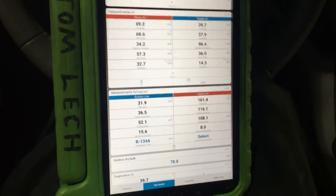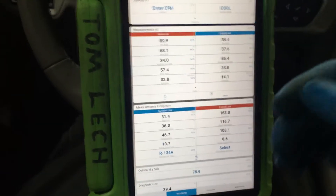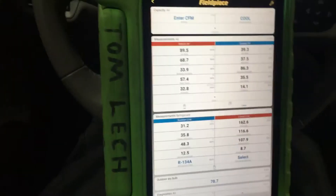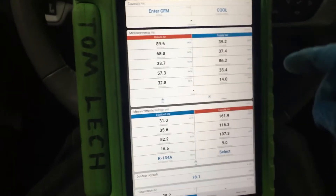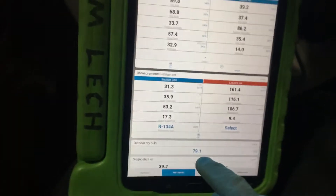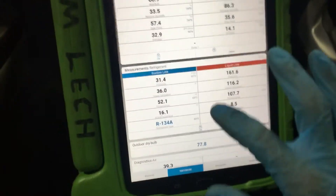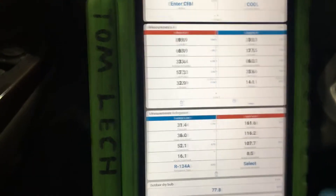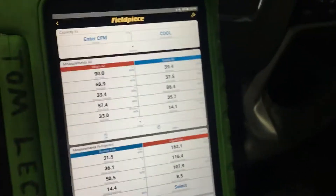Here's a dual AC system. I'm not going to hook up gauges on the rear — I don't have time — but I'd like to take at least one shot today. It's 84 degrees outside right now. My dry bulb outdoor temperature gauge — the sensor sitting in front of the grill of the vehicle outside — is reading 79 degrees. Right now I'm at idle, in recycle mode, and it's cold in the car.